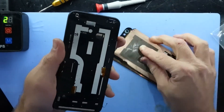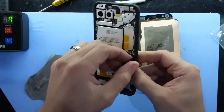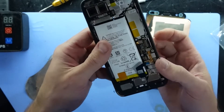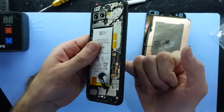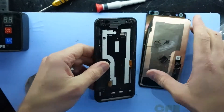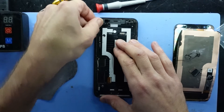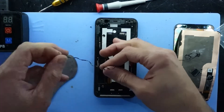Now we'll need to remove the adhesive that is already here. We will be making room by disconnecting a few of these cables and feeding the video cable back through from this side. Just want to keep removing the adhesive that was there from the factory, as it will be getting glued in a bit later.